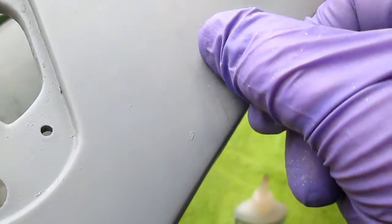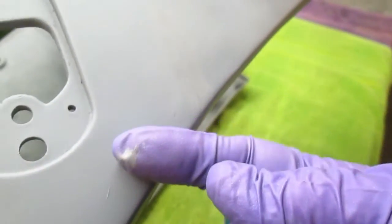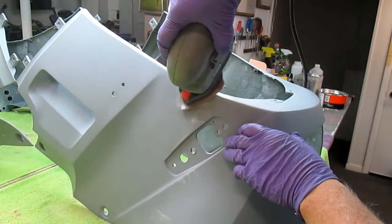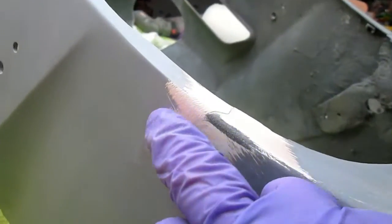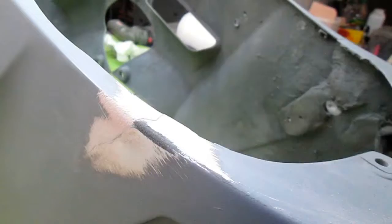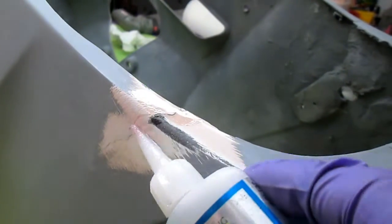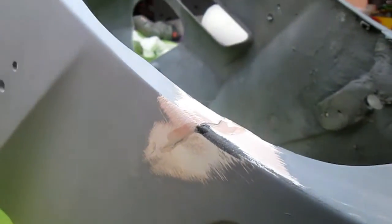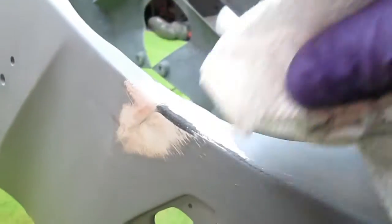So that's the front of our crack right there. I've got 2 coats of thin CA. It's kicked off with the paper towel. Now I can turn this over and reinforce the back with some e-glass. With the paint removed, and now this is a rough surface, I can once again just put a drop of thin CA, because remember, it is capillary. And what'll happen is that's going to go down into that crack, hopefully, and prevent it from cracking again.